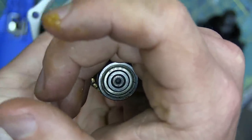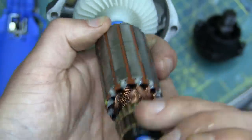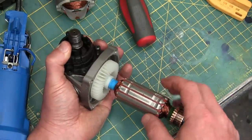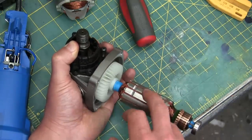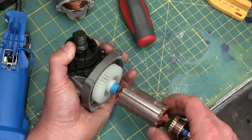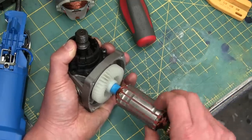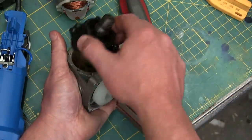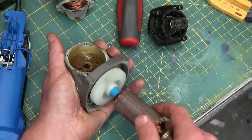The back bearing — no good. It is not sealed; it's just a shielded bearing. So all sorts of debris is going to get in there and wear the bearing out prematurely. Now these motor rotors need to be balanced because they spin so fast — this is turning at 11,000 RPM. What's the gear reduction? This motor has got to be moving like a top. Wait, that's weird — there's some cogging.